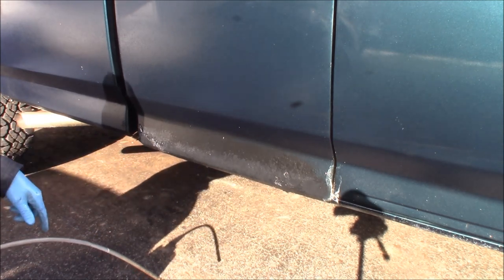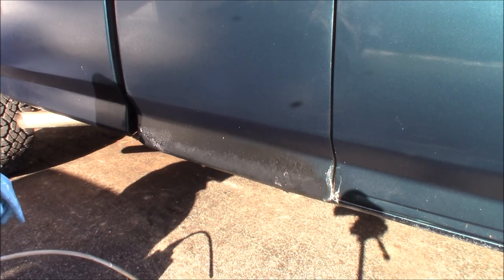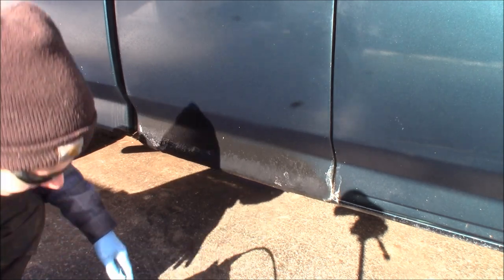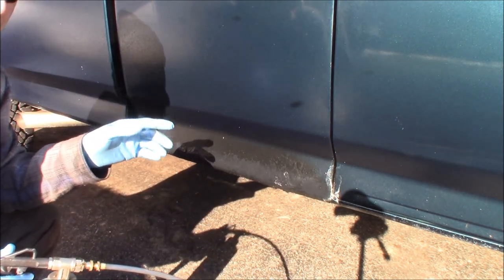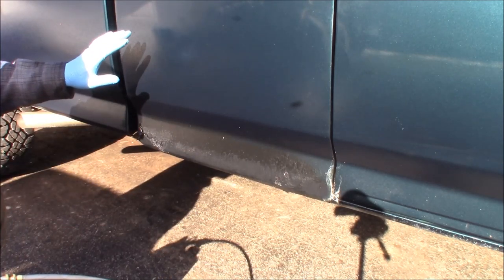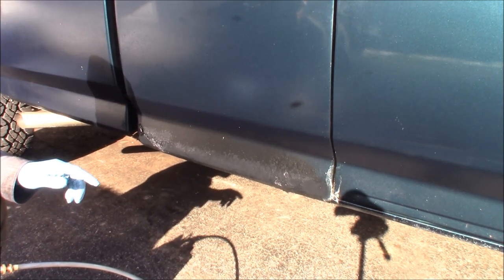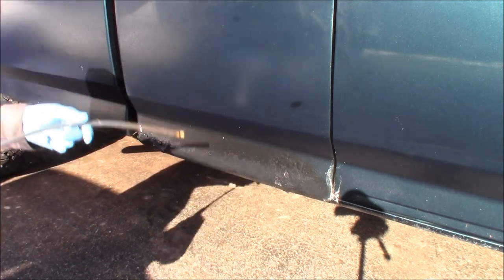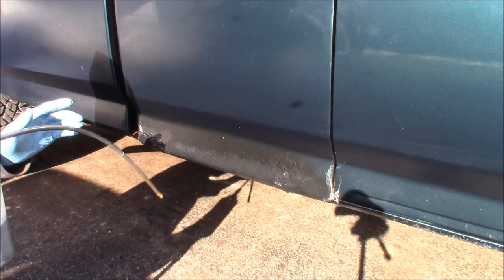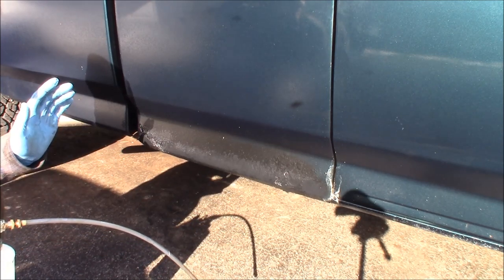There — I've used some Wool Wax black and just put some black on top of the rust. Hopefully this will keep it looking good and give it extra protection. Both of these products are safe to be used on paint, plastic, or electrical connections, but I wouldn't want to spray the black off the side of the truck because it would be obvious. Down here I've got some black spray paint already, so it doesn't matter.